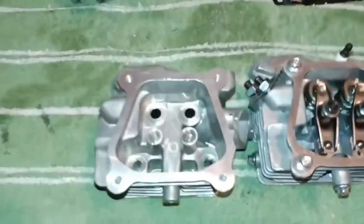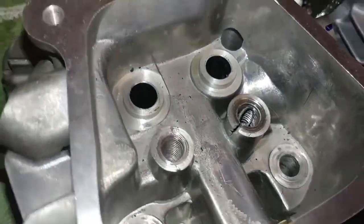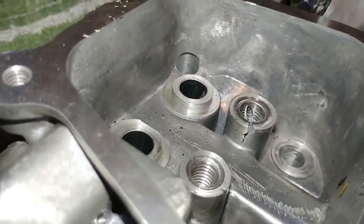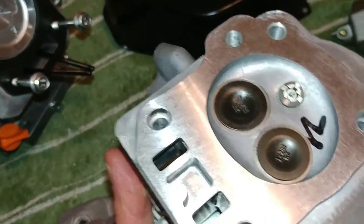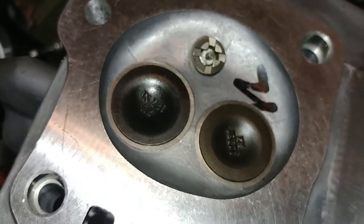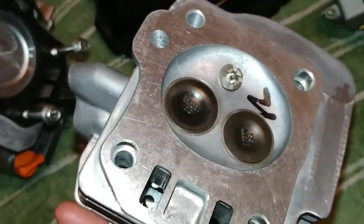We got some good news - the new Predator head arrived. As you can see, I've already got everything taken out of this head. You can see where it busted - I cracked that son of a gun good. I took off the 26-pound valve springs and switched them over to the new head. Everything's all nice, got that nice racing spark plug in there. They only make that for the 212, not the stock CT100U engine - sorry to break the bad news to CT100 riders.